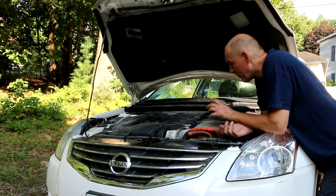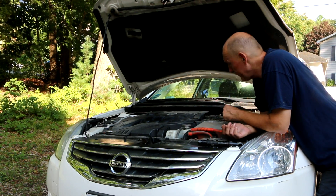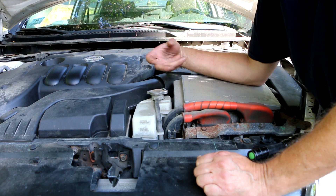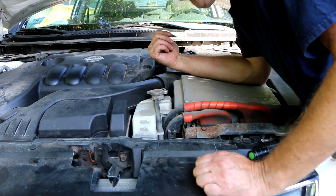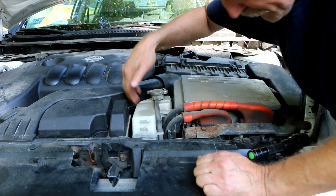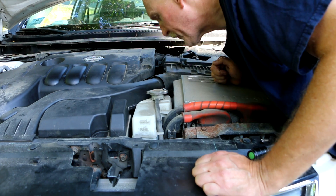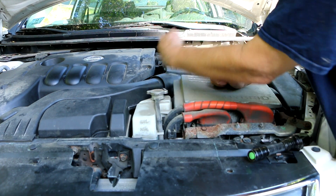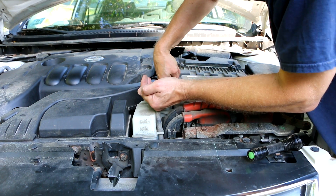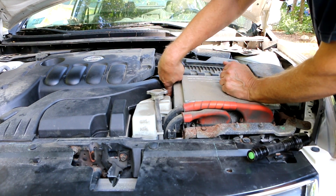Right now it's a bit theoretical for me since I've never done one of these before, in terms of how I'm going to route the cable. I got underneath the car and looked straight up and can see that the cable goes up in this area underneath the radiator hose that comes over to the top of the radiator. It then makes a turn and goes towards the top of the transaxle.